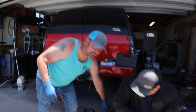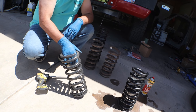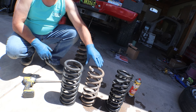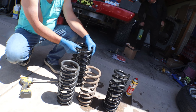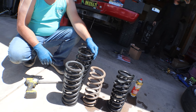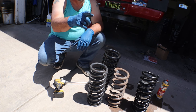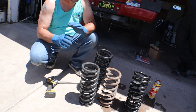I don't want to keep putting my hands anywhere near that. This is the spring we took out of this Buick, and the Buick rode absolutely horrible. Obviously you can tell somebody's chopped the spring. This is one that the customer brought to replace it because he wanted it a little bit higher. Look how much lower that is. Then we got this one which I had him order — this is a two-inch lowering coil. Look at the height difference. Holy smokes. It's two inches higher than this one. Hopefully this is going to make it a much smoother ride, because it rode like a boat with a bunch of lead weights in it. It was horrible. We went ahead and put brand new ball joints in the car too, so everything will be new once we put the spring in.